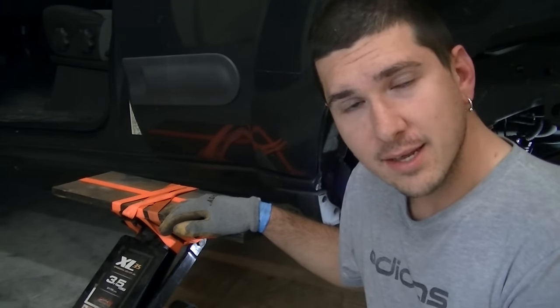That's the front — now we're going to remove the one bolt from the rear and we should be able to drop the tank. Now we're at the moment of truth. All of the weight is on the jack and all straps have been removed, so we're ready to start lowering the jack and getting the tank out from underneath the truck. I cannot stress enough how important it is to just be slow, methodical, and careful here. If you see something going wrong as you're lowering the jack, stop and figure out what's going on. Also note that I didn't fully remove the fuel filler hose, so as I'm lowering the tank I need to make sure that hose releases correctly.